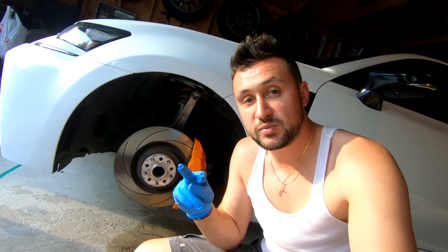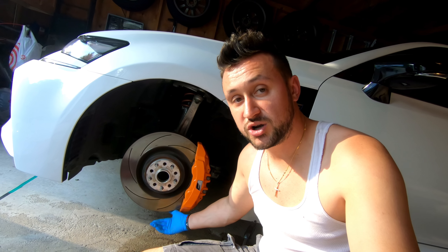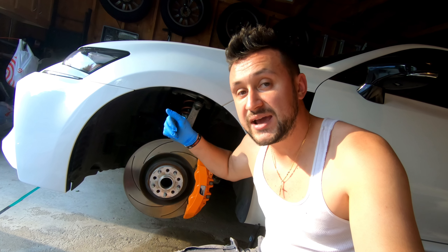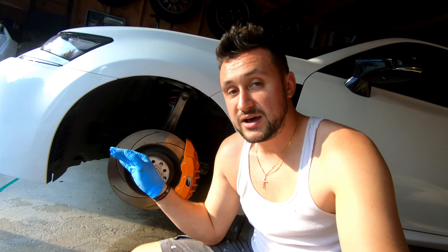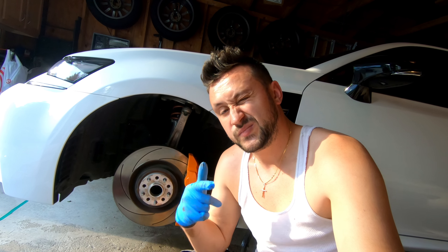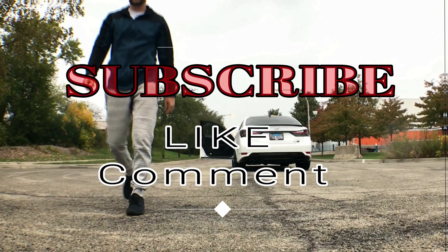That's it — I did both sides, left and right: the two upper bolts for the upper control arm and two lower ones for the separate lower control arm bushings. I loosened them, jacked up the lower control arm until the body was lifting off the jack stand, then tightened and torqued them to spec. This should prevent the bushings from having excessive wear given the car is lowered more in the front than stock. Please subscribe, and if you have any questions, comment below. See you on the next one.